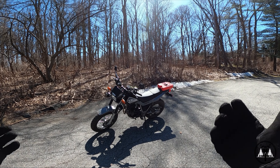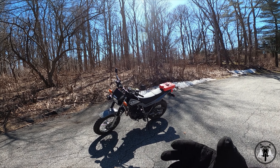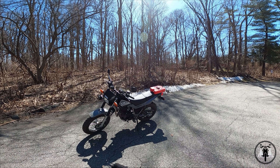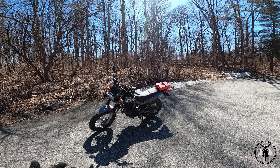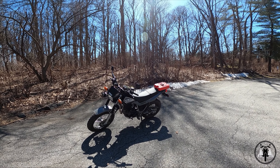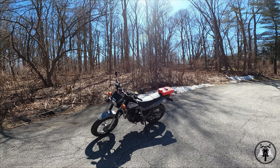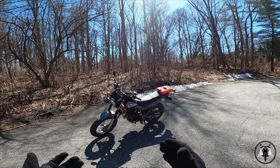I've had a couple of people say that because the bike is carbureted, it may not start up right away or it takes a while to start up. I do agree that when the bike is cold, you might have those issues where you might have to pull the choke out and let it run a couple minutes. But just like any motorcycle, it's a good idea to let it run for a minute or two before you get on and ride anyway.